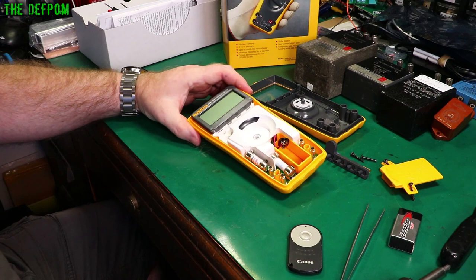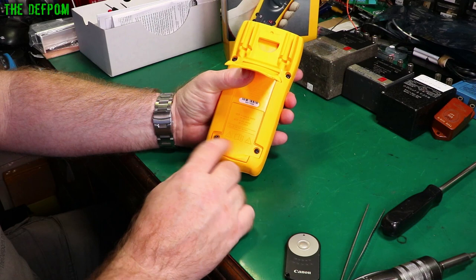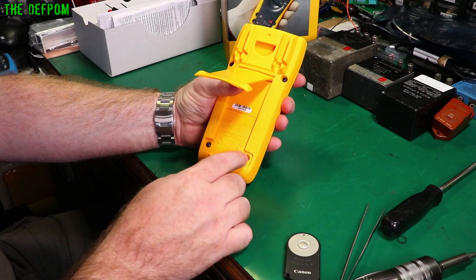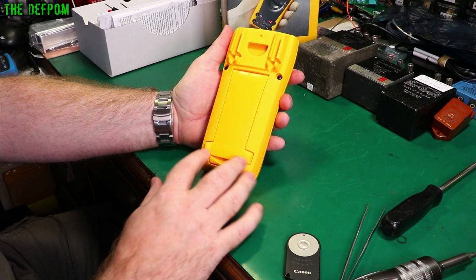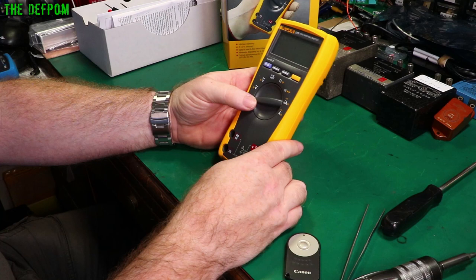Let's finish putting it back together. The battery cover screws — it would have been nice to have metal threaded inserts here, since you will be changing the battery from time to time. The technique for plastic screws is to go backwards first to drop into the existing thread before screwing in, so you're not cutting a new thread each time. Anyway, let's see if it still turns on — it does! Display still works. Looks like I didn't break anything.